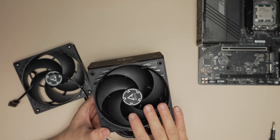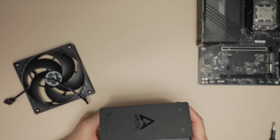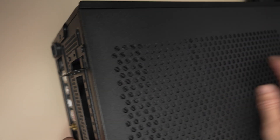I was a little concerned about this at first because I tested it in the NR200 — this cooler is 159mm tall. I validated that, and it somehow fits in the NR200. On spec, it's 0.5mm taller than the Noctua U12A I usually have in there, and that one is a tighter fit somehow. This one does touch the side panel and you can tell there's a hint of a bulge, but it's really nothing noticeable. Testing was done with the ASUS X570i, so case-to-case variance may apply, but if you're thinking of building with the NR200 and this cooler, it's a very worthwhile option because it works incredibly.